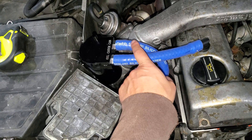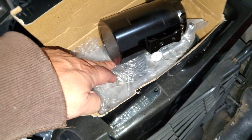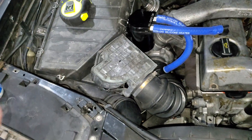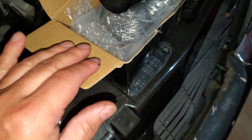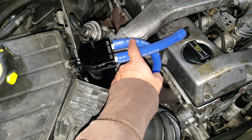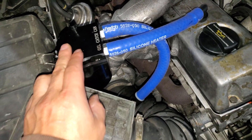I'm going to take it out and look inside to see if there's any oil residue down the pipe. If there is, I'll probably use the stainless steel mesh so when it bounces the oil doesn't spill over. This is a Mercedes-Benz so it doesn't bounce much — it's not like I'm taking it off-road — but if you do go off-road you need to use the mesh, otherwise the oil will jump up and get through the suction side, which defeats the purpose of the catch can.